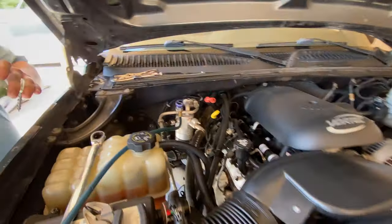There's this little elbow right here, and this little tray comes out from the AC box where the evaporator is. All that moisture being created on there is what's draining out. The evaporator is inside the car behind the dash, so you can't see it from here.